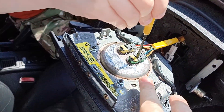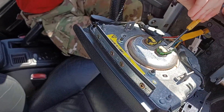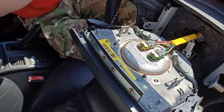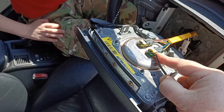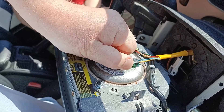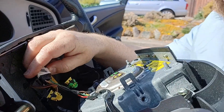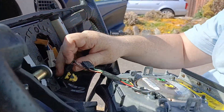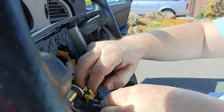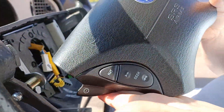In the back of the steering wheel there is the clock spring, which is quite important for letting the electrical signals pass through the steering wheel — to the horn, the airbag, the volume up and down buttons, all of that. If you break that, I think it's about a £50 or £60 part, and of course none of that will work — you'll get an airbag warning light if that doesn't work. There's the explosive airbag successfully removed.